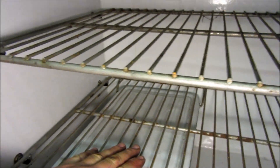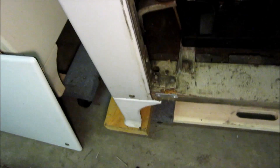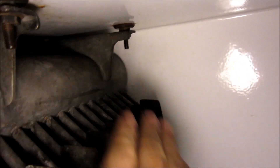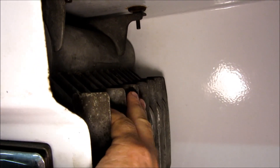One thing about these belt-drive units: since it's a mechanical device there's going to be some vibration. The furniture dolly doesn't help, but that's one of the things where the newer ones are better. It's already getting cold though — you can see the sweating on it. It's probably more than 90 degrees in here, so it's just having to work hard. These cooling fins get cold from the evaporator and then cool the whole fridge off.